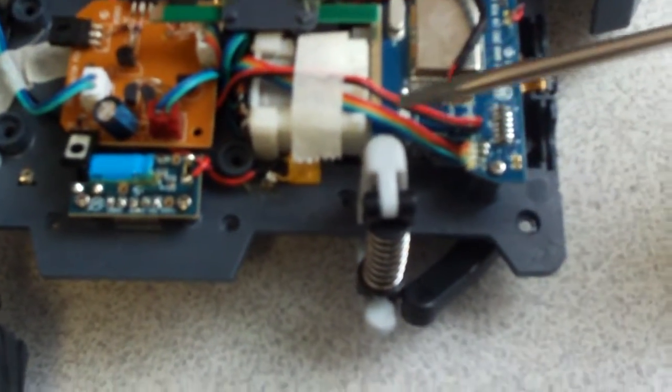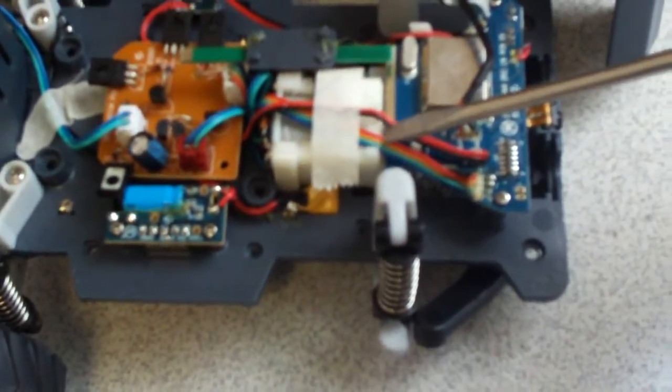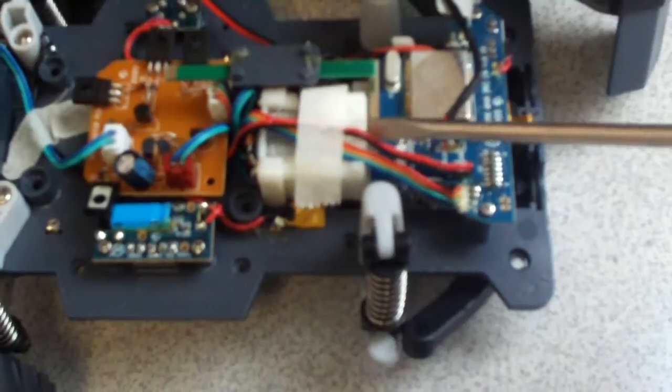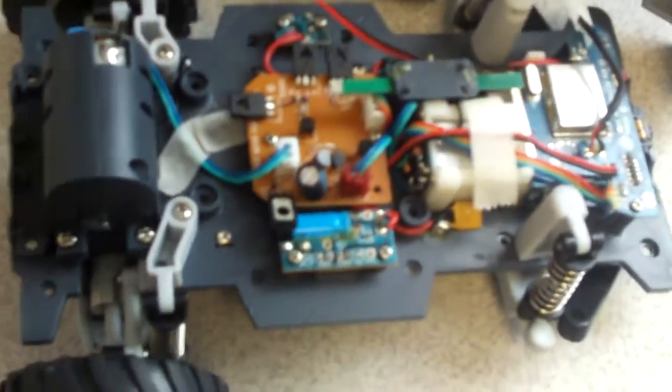And if you guys are having the same problem, you get some low-paid budget worker working at a factory assembling thousands of these for all the Call of Duty fans, that stuff is going to happen. So if your video is not working, go ahead, open it up, see if that's your problem. Second bet would be all these crappy connectors in here too, like that looks loose. There's those connectors again, here and here. So if one component's not working, I would suggest looking at your connectors first, and then see if it's getting power. I think my camera is just not getting power because these wires are pinched, so I'm gonna get some alligator clips out and see if it works.